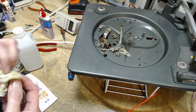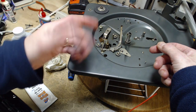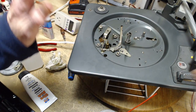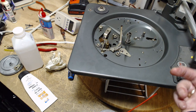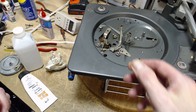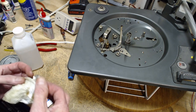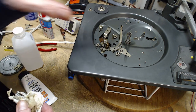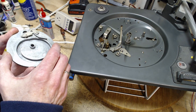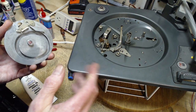That's why it's called a velocity sensor — it's dependent upon the speed at which this is moving. That's also why, if you have one of these record players and you pick up the needle and decide to make it go automatic by moving it towards the center, it picks up all of a sudden before you even get to the center. That's because of the velocity at which you moved it. If you want to move it all the way to the center for testing, you've got to move it just about as slow as it moves when playing the record — very, very slowly. These things are occurring as the record goes around. If you could hear them loudly, they'd transmit right up into the platter and out of the speaker, but normally the music is covering it so you don't hear any of it.